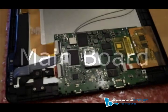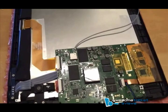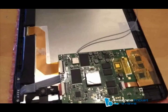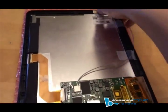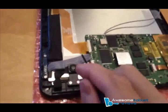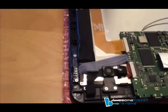Now focus on the board. Remove the screws here, here, and here, as well as unplug the ribbon cable for the LCD here and here. You'll also have to remove the ribbon cable for the camera. Take the antenna and unhook it from here. You'll have to flip this board because the IDE-style cable for the side buttons does not unplug.